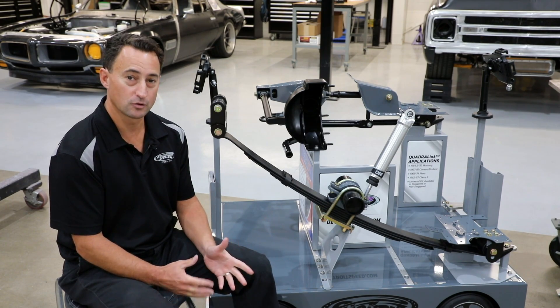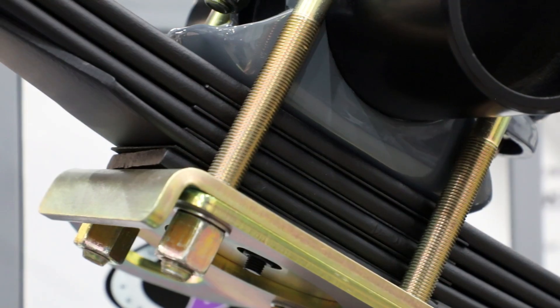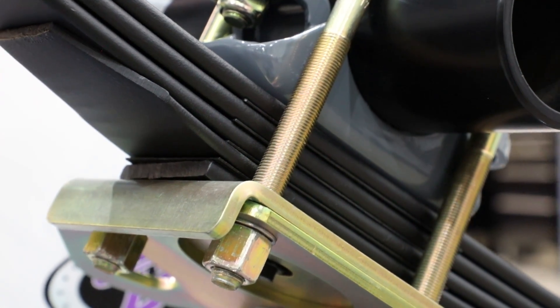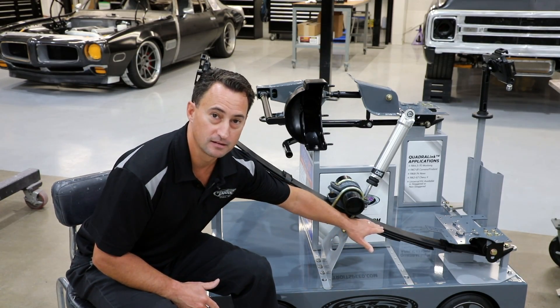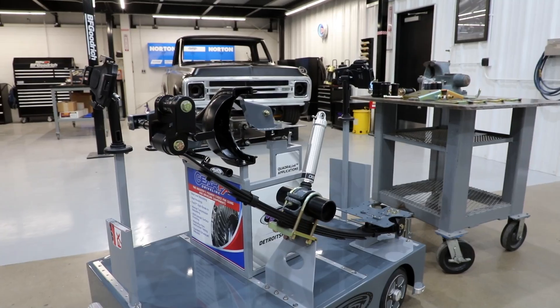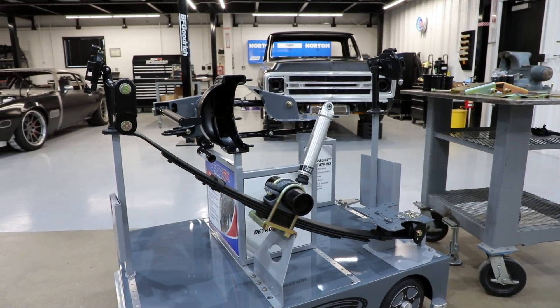Some of the features when shopping for a drop leaf spring include an anti-friction pad between each leaf, which will help you with a smoother ride, along with a tapered leaf design. Another thing is that our leaf springs are front biased, so under hard loading, the axle is actually going to try and wrap itself around the leaf spring. When the leaf spring is biased to the front, that'll help control that from happening.